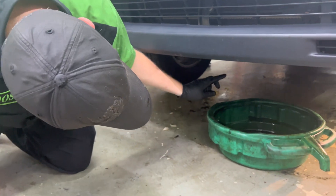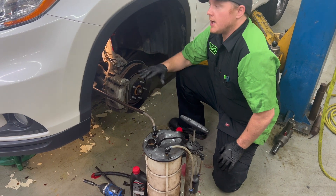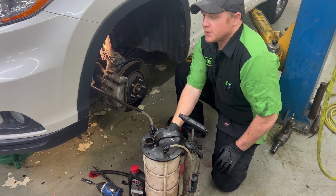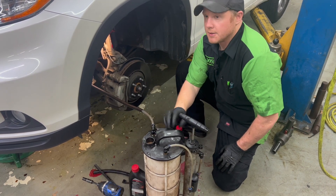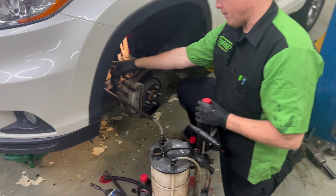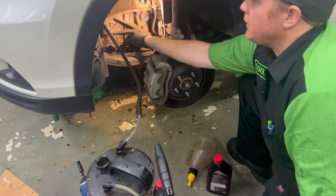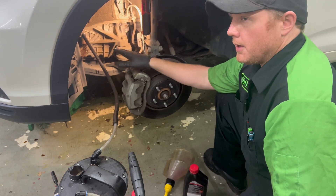So at this point we've got our two hoses pointing down into our catch pan. Now what we're going to do is actually overfill this transmission by about three or four quarts. We have a tool that is both a vacuum and a pump — we only use this thing for world standard transmission flushes. So even though it may appear dirty, what's inside of it is clean world standard fluid. We'll go ahead and put our fluid into it, running on a three-eighths fuel line directly into the fill plug of the transmission. They do make adapters that thread into that hole and kits with little pumps threaded in, but this works just fine.